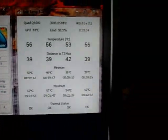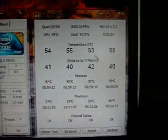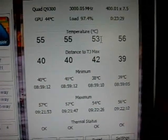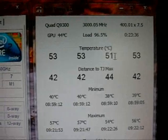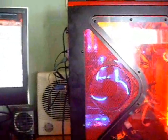Okay, we've been running Prime95 for about 40 minutes or so. Doing the screen recording and stuff is raising the temperatures a little bit more than it probably should be. But as you can see, all our temperatures are right around the mid-50s — 53, 52, 53, up to about 55. Pretty nice improvement over the 60 or so we were getting before the lapping. I'm pretty happy to get a five degree temperature drop — well worth the little bit of time it took to get it lapped.